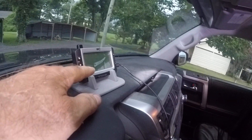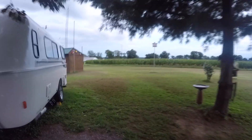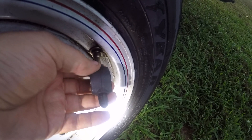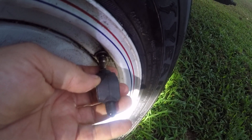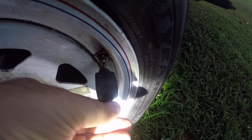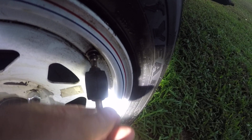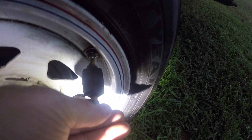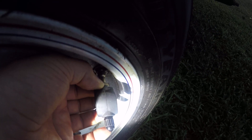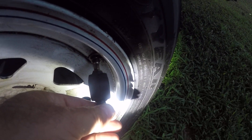This is mounted inside the vehicle. Let me show you where I've installed the actual tire pressure monitoring on the Casita travel trailer. You can see it has a locking ring, and you basically come out and install that inline on each of your tires. You can inline add or take pressure out without having to remove this. When you get this, there will be a little tool that comes with it that helps you lock it on here, and you can use that to unlock it to remove it.